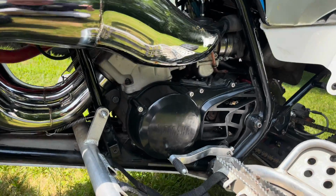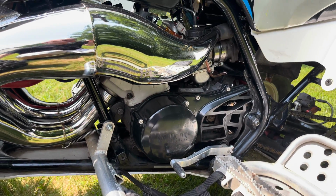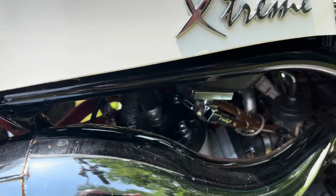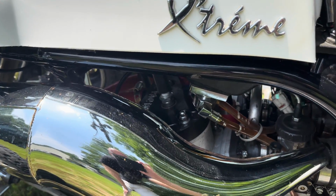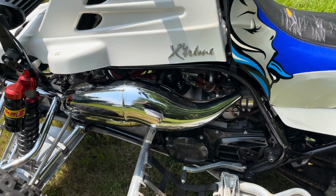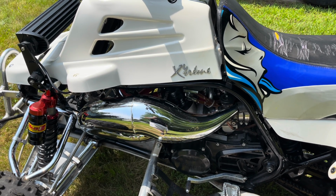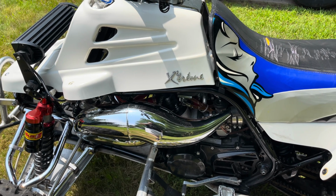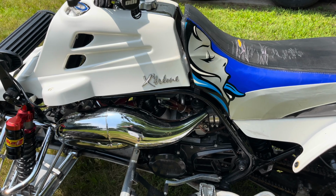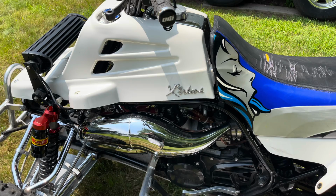But obviously we got that Serval cylinder on there. Like you said, Redline Racing in Oregon ported it. He got me the cool head, it's hard to see in there. He did the whole motor. I just sent him cases, and he assembled everything. He jetted it, he put it on the dyno and everything. And like I said, 90 horsepower to the back tire and like 50 pounds of torque. It might be like 89, but it's right at like 90 horsepower. On pump gas, that's pretty damn good with an airbox.